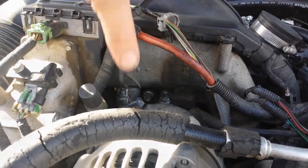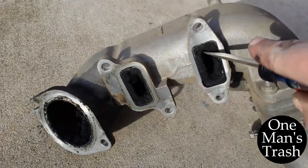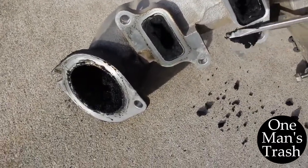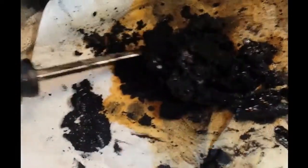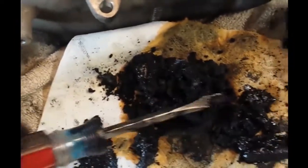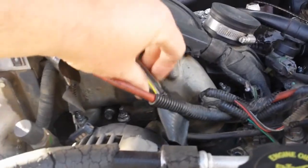The oil comes up and mixes with all the diesel soot coming in from your EGR. Now I'm here in California so I don't have mine deleted, but with that diesel soot and oil all mixed together in there, it makes a big mess — totally clogs this whole intake up with what looks like tar, kind of the consistency of tar.